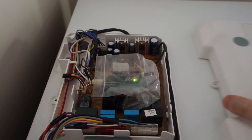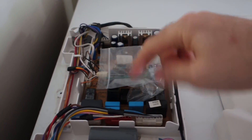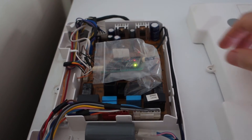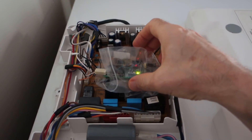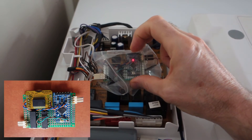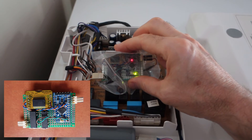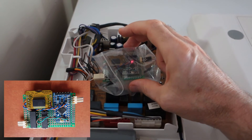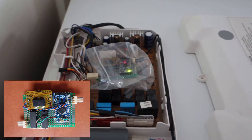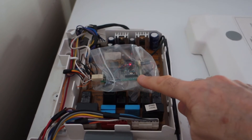What we have here — the control cabinet lid is removed, and inside we can see the main board. I've added a little Arduino circuit here; more details obviously on the instructable. We have an Arduino Nano, a real-time clock at the back of this circuit board, and a couple of reed relays. The reed relays are simply wired in parallel with the buttons on the front of the fridge.